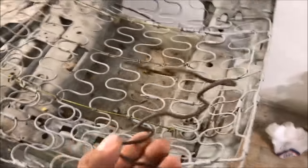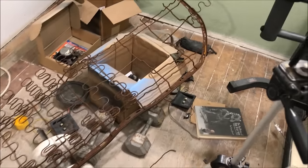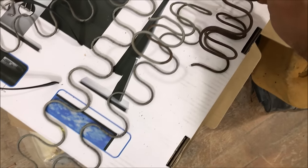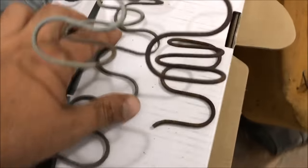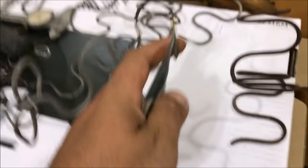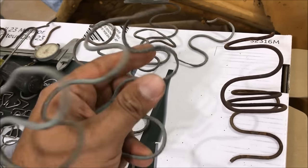Here's a repair I made — you can see the broken spring and the replacement section. Anytime you make a repair it's got to be double-strapped. They sell kits on eBay with clips, but the best thing to do is find a donor seat — a 69 four-door lower seat — and use almost every clip off it. Healthy springs are an eighth-inch diameter, pretty strong; you can bend them with pliers but not by hand. The test: if you squish a spring and it doesn't go back to shape, you need to repair or replace it.